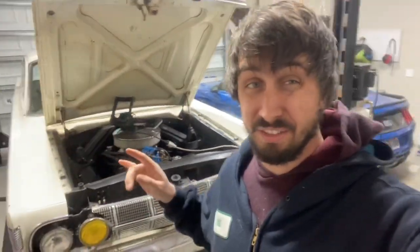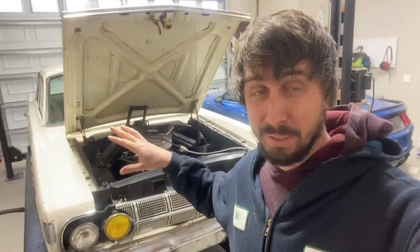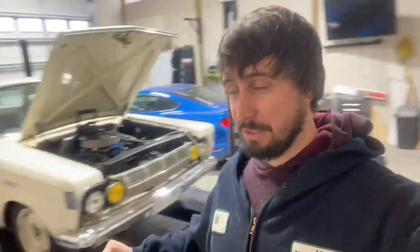We're going to skip some steps because I've been underneath that dash messing around with the linkages, and getting that clutch pedal in there is the least fun part of this entire swap. If you have a car that already has a clutch pedal, it's a lot easier. We're going to adjust the slave cylinder, install the reservoir, route the lines, and do all that. If I were to connect the linkage now, when it's time to bleed the system I'd have to disconnect it all anyway — so I'll hook everything up and put fluid in first, then come back and adjust the linkages.